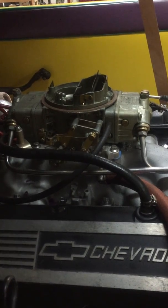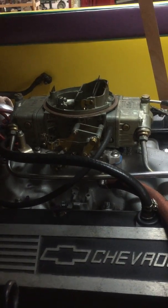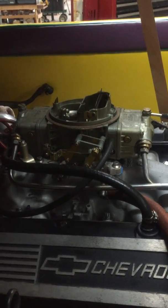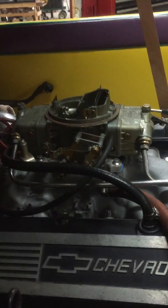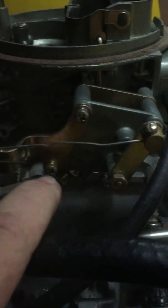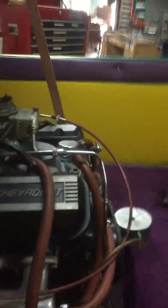As the engine warms up, the requirement of the rich mixture goes away — you don't need rich anymore. The way to get a rich mixture for starting up purposes is the choke. The choke is this little flapper valve right here that should shut. The problem is it's being held open — doesn't that look like a paper clip right here? So that's being held open with a paper clip. To compensate and give you a rich enough mixture to start your engine, the carburetor has been adjusted to run rich.